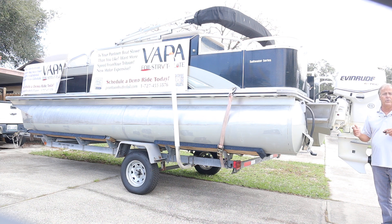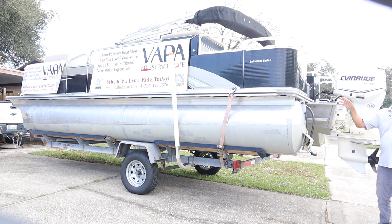We need the longest overall dimension of your pontoon to calculate the center of gravity. The longest overall dimension happens to be from the center of the cowling of your engine — in this case it would be the R on the Evinrude — to the furthest most point of your boat.